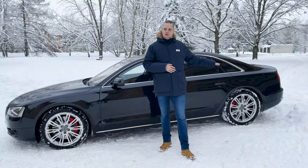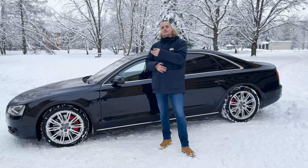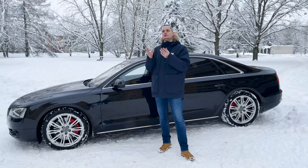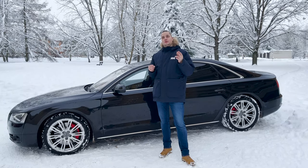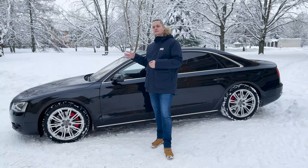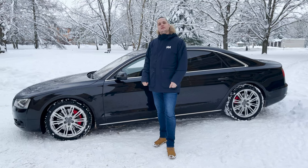The AMI and everything else I will show you in a bit, but in this video I will also show how you can make the right format for the front monitor, or use it in the rear also, for the SD card or in the jukebox. When I bought the car, the forums said the video resolution should be 720 by 480 and the codec should be MPEG 1 or 2, but the quality wasn't very good. So I dug a little more and found the right codec, and I used one of the programs I will show you in a bit. I got the maximum quality the monitors support. I will show you that inside, but the Chromecast install is outside.